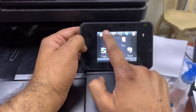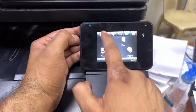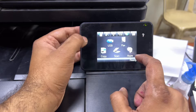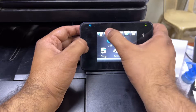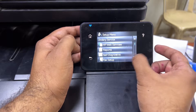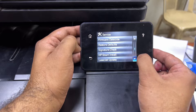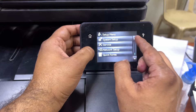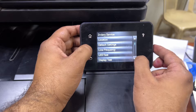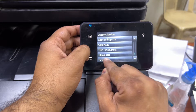Touch the settings button, then quickly press in the middle and press the cancel button. You will see the screen again, then press the settings button again. You will see 'Secondary Service' appear on screen. Go into Secondary Service, then go to Service, click on Secondary Service itself, then scroll down and select 'Pick Roller'.